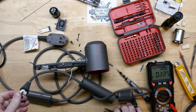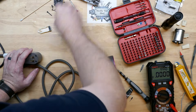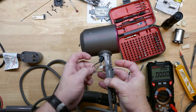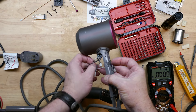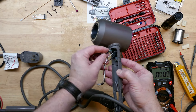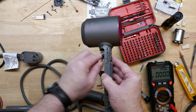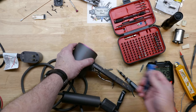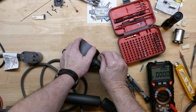Now let me put my screws back in order. As we route our wires through and get them all towards the opening, it's very important that we don't let the wires get caught up, because they can easily get ripped from the board. If you feel more comfortable taping them up you can do so. I've done enough of these that I just go very slowly and have patience as I turn, making sure they don't get caught.